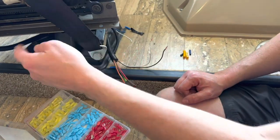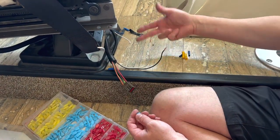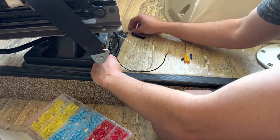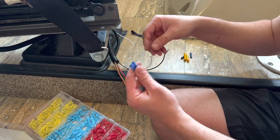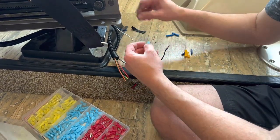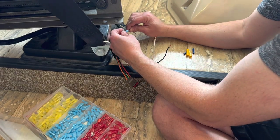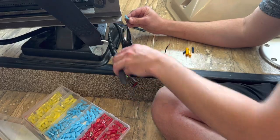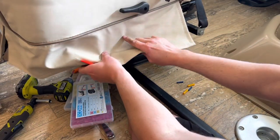To get the wiring harness off the chair, I actually had to cut the wire that goes down to the battery or fuse block. It looked like it had been done before because there were just some butt connectors there. So I'm going to put a quick connect spade connector on there so that if it ever has to be done again, it'll be easy to just slip off.